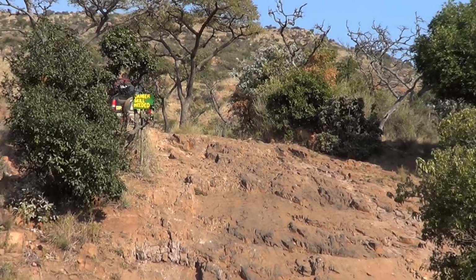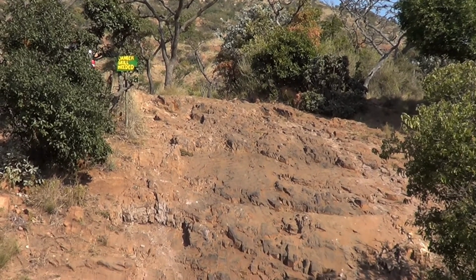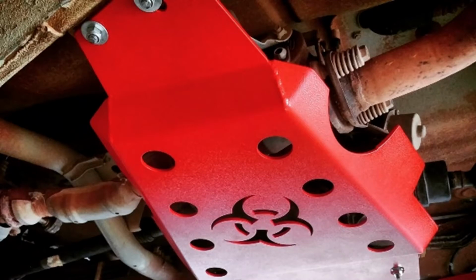The transfer case does have an aluminium casing, and that aluminium casing can get damaged quite easily by rocks or stumps, any type of debris you can get off-road. Maybe just have a look at the position of that transfer case plate on your car. When you power wash your chassis after a long drive, make sure that there are enough drainage holes for the water to get out. The transfer case also gets hot, so good ventilation is a must as well.